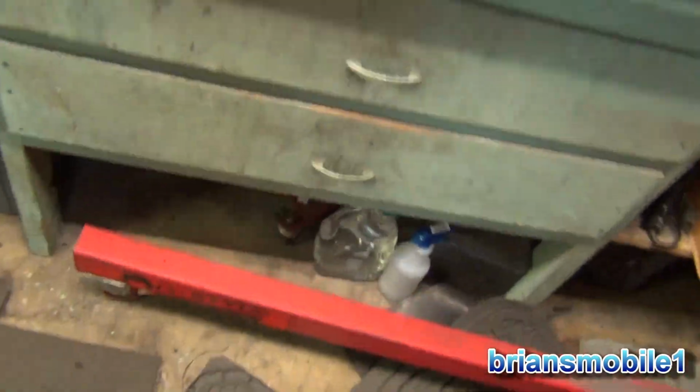Before I condemn this line and get all crazy about pressuring it with the air compressor to make it hiss or smoke or do something, let me show you what I got. I've got a bolt shoved in there. It's shoved in pretty far, but it's really coarse thread. I know it's about this size, so I'm going to go to my vacuum plugs. Good to double check stuff, because you can spend hours down the wrong fork in the road, you know what I mean? So we'll set that there.